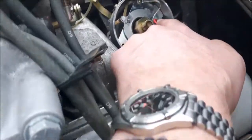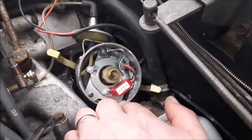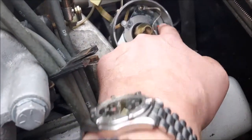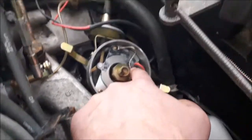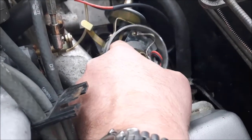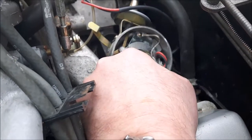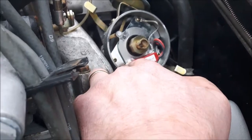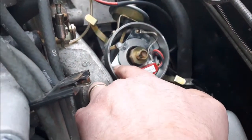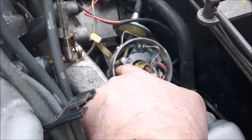So this is it all fitted in now. We've got the two wires coming through a grommet on the side of the distributor body. There's enough flex on the two wires so the base plate can move without stretching them. There's also an earth wire that connects the top plate to the base plate — the top plate is in danger of being insulated because of rubber connections, so that earth completes the circuit. The base plate is screwed back in place of the original.